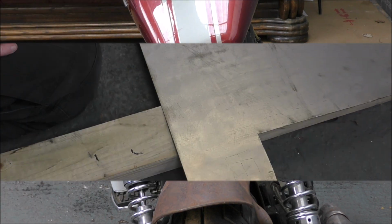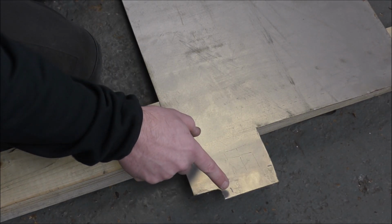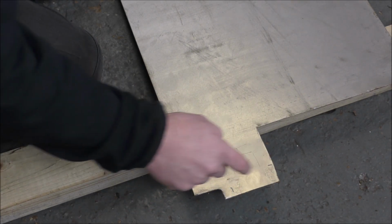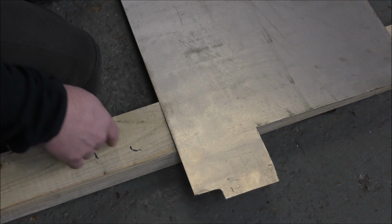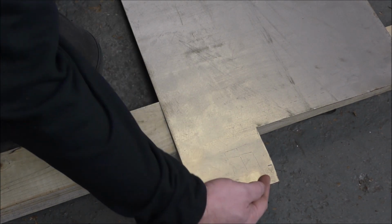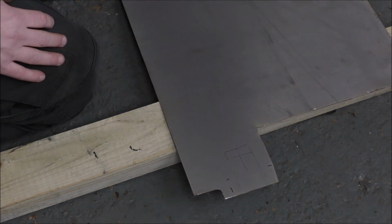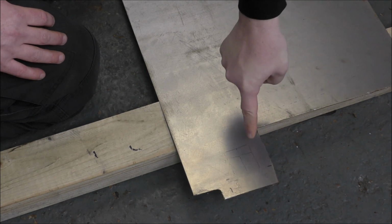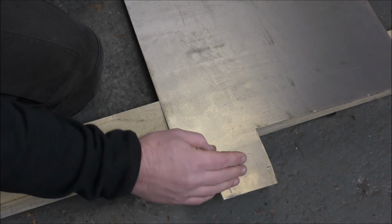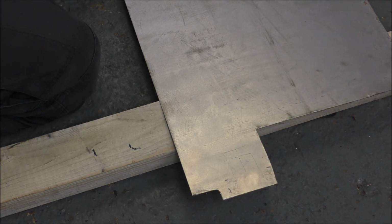Right, so now you've finished playing with your wobble board, what's all this about? Okay, so we've got a 70mm wide to curve over the arch. We've then got 30mm deep, just because, and we're going to drill a couple of holes in and we can bolt that down to the bracket under the wheel arch. And then these tabs here, the longer one of the two, by the time we've cut down the middle and curved that, when it's bent up, they'll move out, so then create like a V to attach to the back of the bracket on the light. Cut there, and then slice down the middle? Yes. When we curve this piece, with them bent up at 90 degrees, they'll move apart like a V. Will it be enough of a V? Well, we can trim it, it doesn't matter.